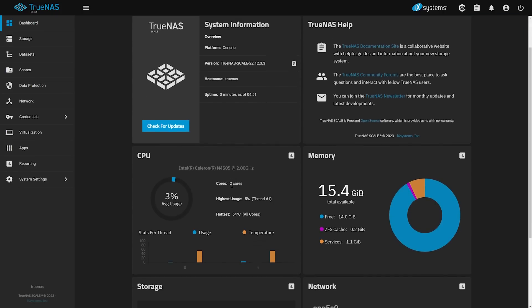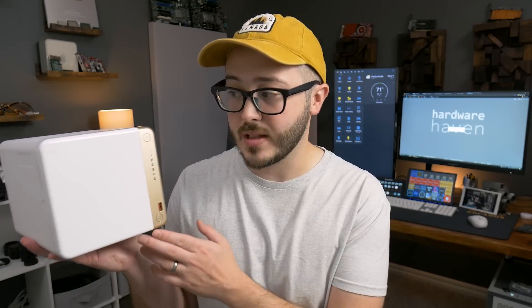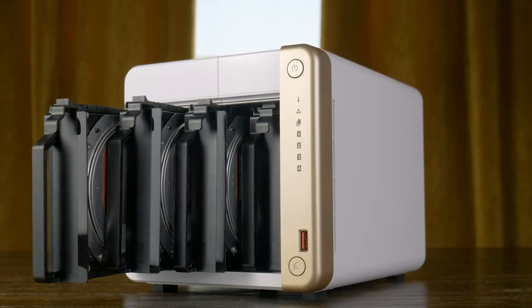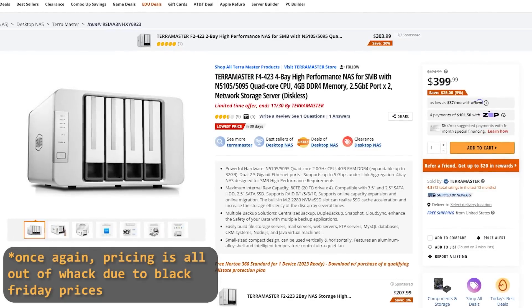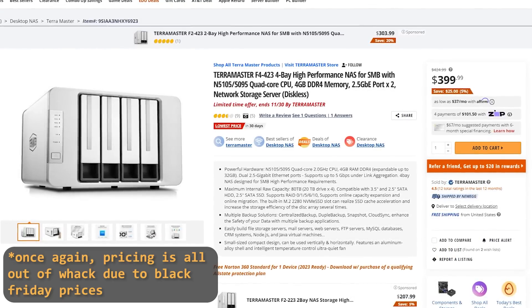I do have to mention security issues, as QNAP has been in the news for quite a few security vulnerabilities. If security is a huge concern, I would probably just stick with Synology, as they've had a better reputation. In general, my advice would be not to expose your NAS to the internet at all — and if you do need to access it from outside your local network, use a VPN. While it's great that you can install something like TrueNAS on this, I would not recommend buying it for that express reason unless you really like how it looks. If you want something small and compact with 4 drive bays, I'd actually recommend looking at Terra Master — they have a 4-bay NAS similar to this but with a quad-core CPU and dual 2.5 gigabit NICs that is slightly cheaper. So if you're looking for a simple, solid NAS that you don't have to tinker much with but don't want to shell out for Synology, the QNAP might be a good choice.